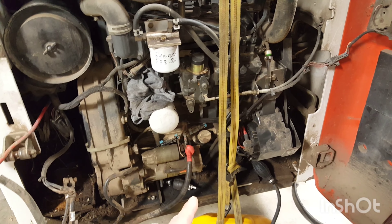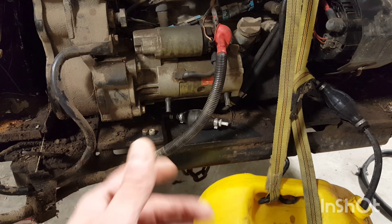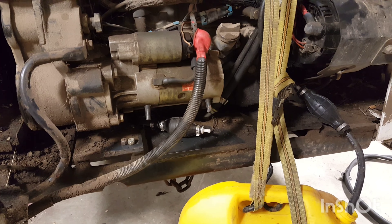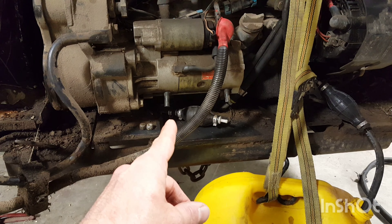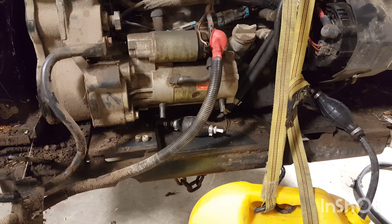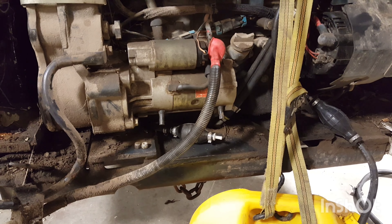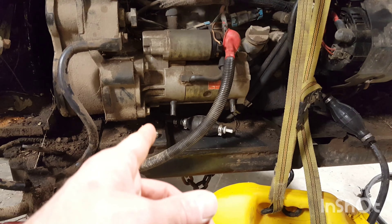I followed the line back down, took this line off the end of the bulb right here, and tried priming it again. Of course it was an old one, and in wintertime the rubber is really hard. I squeezed it and nothing was coming out, so I took the bulb off and blew air into the line — couldn't hear anything. I thought maybe the gauge was bad, so I dumped in five more gallons of fuel and blew back into the line. I could hear it bubbling but couldn't get any fuel coming out. Tried pressurizing the actual fill tube — nothing. No fuel coming out, even with just the hose and the bulb off.